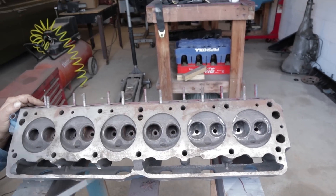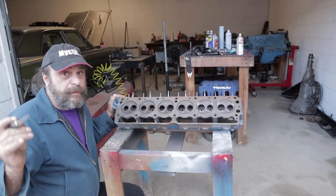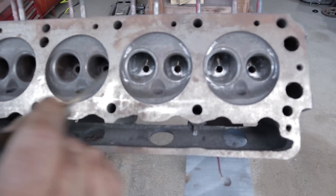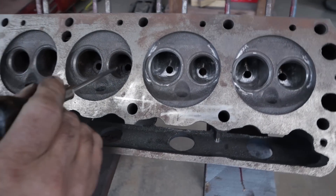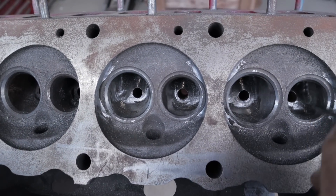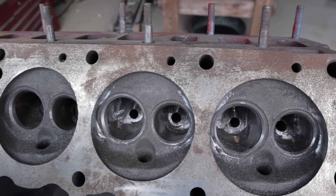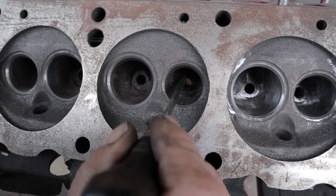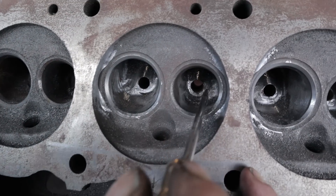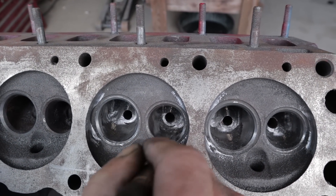We started porting it. Look, don't judge me — I'm going to be the first to admit I have the porting skills of Stone Age Man three days into an opiate rehab, but it doesn't have to be pretty to work. We've done these two cylinders — they're roughed in. On the exhaust side there's not much to do other than cleaning up the bowl area under the seat. You can see here it's nice and smooth, evened out and in line with the seat. We got into the seat just a little bit, but that's fine. The big thing on the exhaust side is this lump right here — that's the outside of the valve stem opening. We've pretty much eliminated that completely and blended the areas on either side so the exhaust has no sharp edges to catch on and has a free way out.